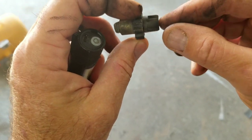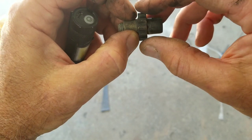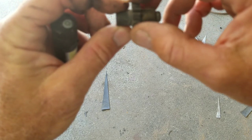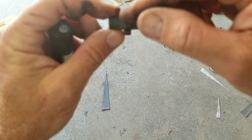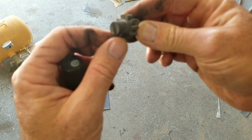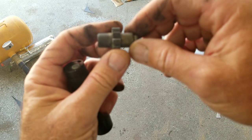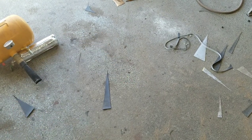This adjuster is up against the wheel cylinder, and you want this part to get longer. Turn it clockwise when it's going this direction to do that with your screwdriver, making this part go longer. When it's facing the other direction, you go counter — downward — but you're still moving it the same way to lengthen it. If you've never done it before, it's a good idea to take the drum off, look at what you're working with, then it makes it easier to figure out.